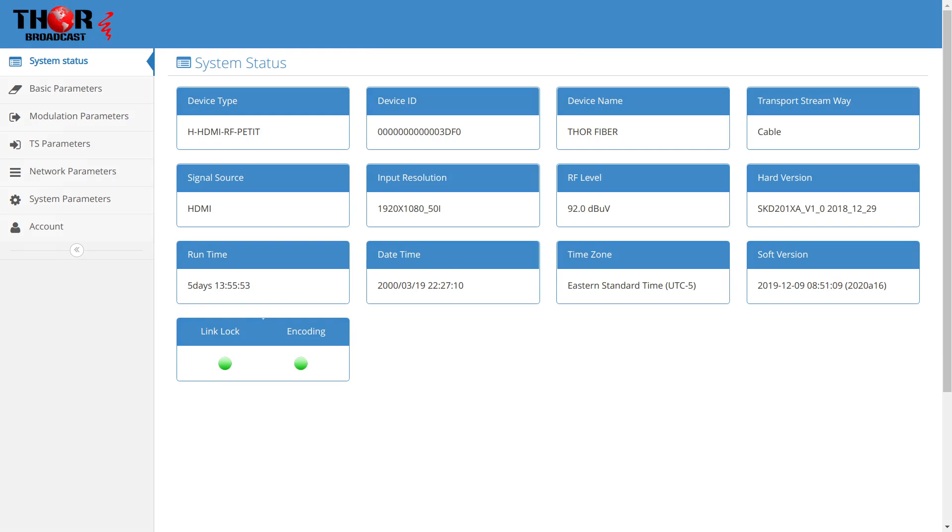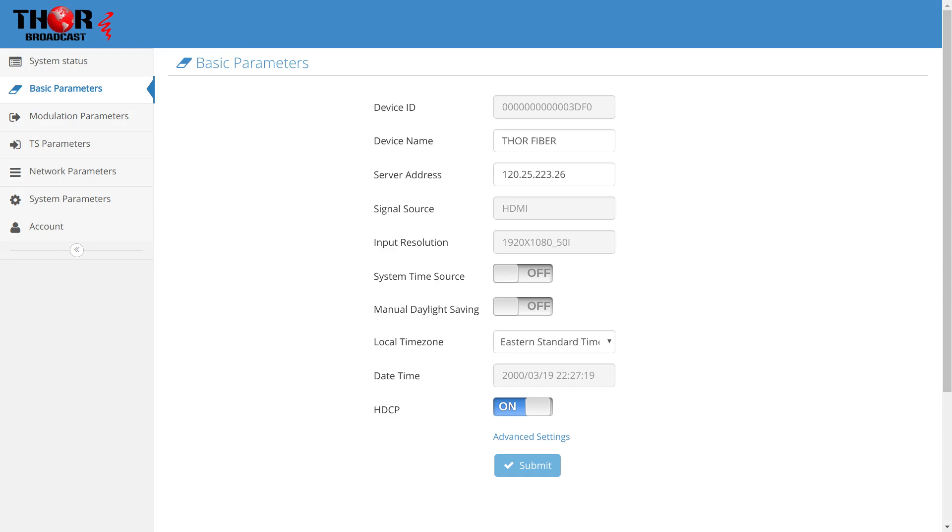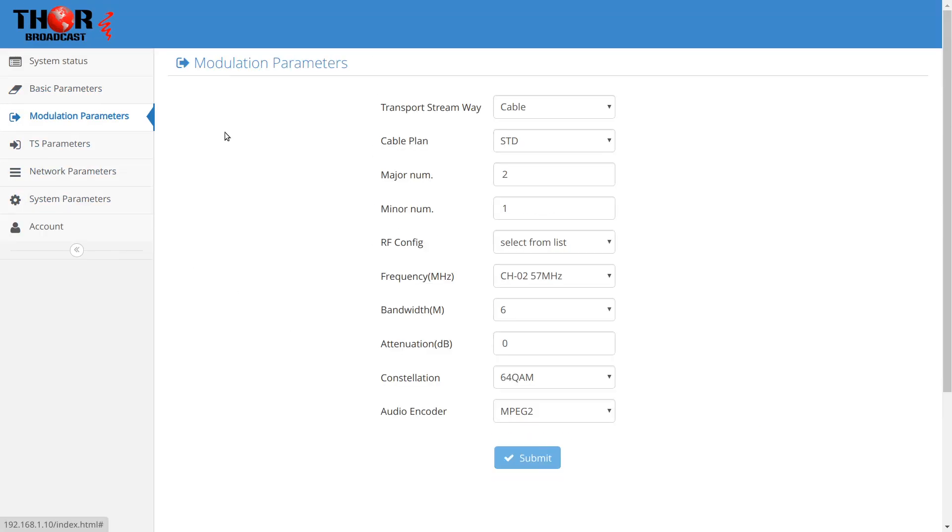Here's the status of everything — it's encoding right now. I have it connected up. You can set the time and all that. It's picking up the HDMI. I have this set to on. You can fix the date here. Now I had it set to cable, but I actually want to switch it around. What I've done is changed the MPEG audio from AC3 to MPEG-2. You can select either cable or air.